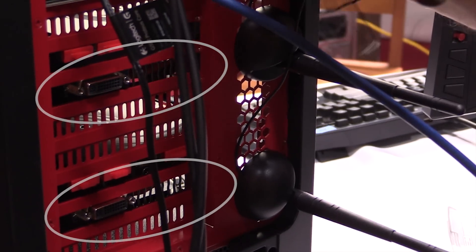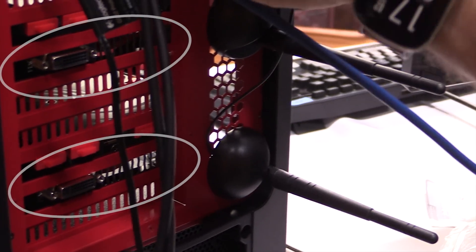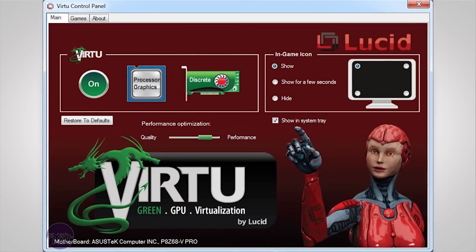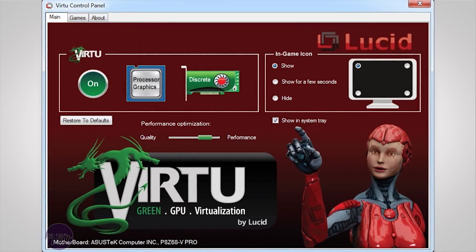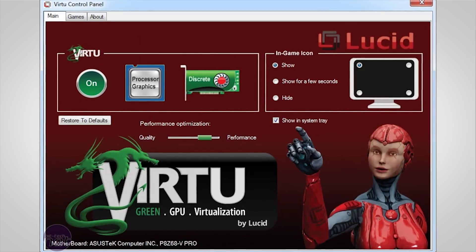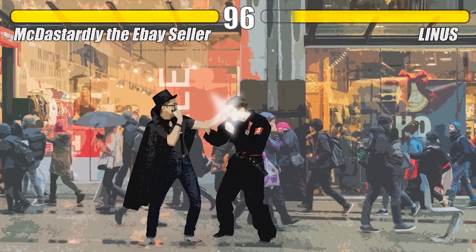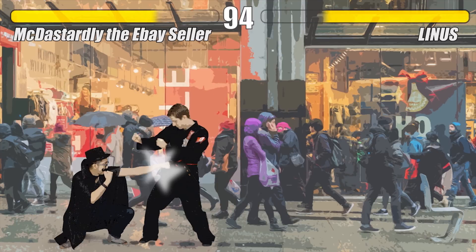While we're on the subject of cables — when you finish your build and are getting ready to plug in your monitor, for the love of all that is good, don't plug it into your motherboard if you're rocking a discrete graphics card. Although software solutions that allowed you to plug your monitor into either one and still reap the performance benefits of your GPU once appeared to have a bright future, these days a connection to your motherboard will completely bypass your graphics card, leaving you wondering why you're getting five frames per second in a game where you were expecting to get five hundred.